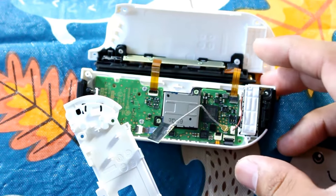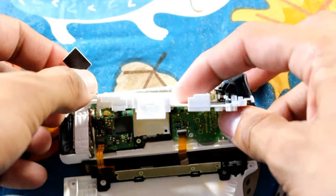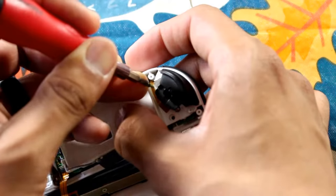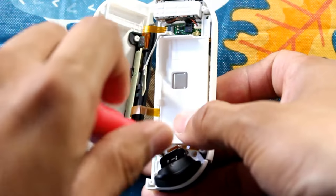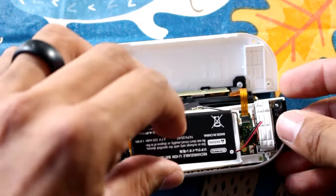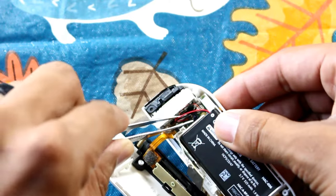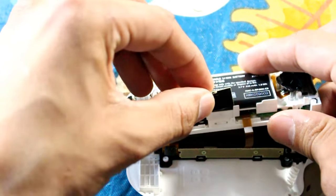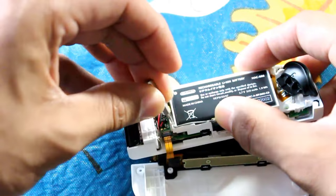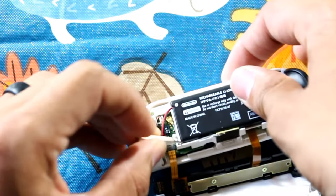The other sensor was reconnected off-camera — all you do is pop it down back onto the connection and it's secured. Take the middle piece and roll it back over to where it belongs. Replace the screws back where they belong so everything doesn't move. Grab the battery, set it back in, and reconnect it the same way it was disconnected. Take the sensor and slide it back into the slot just below the battery. Use some tweezers to fish that cord back inside the slot so it doesn't stick up and impede closing of the Joy-Con or damage anything.